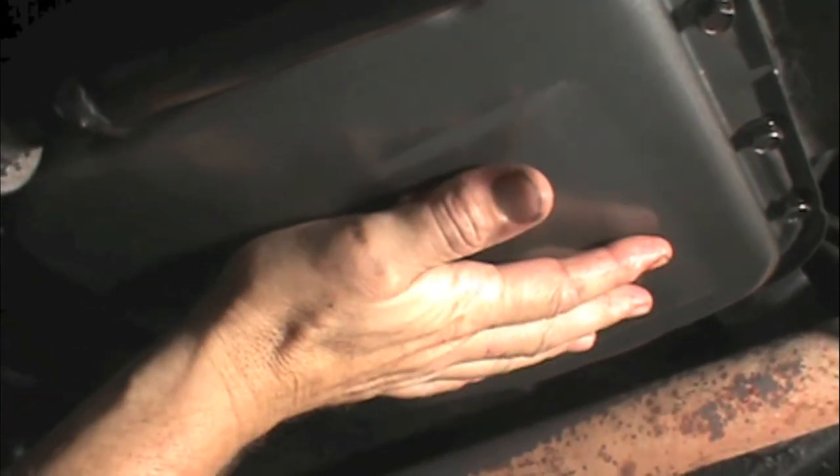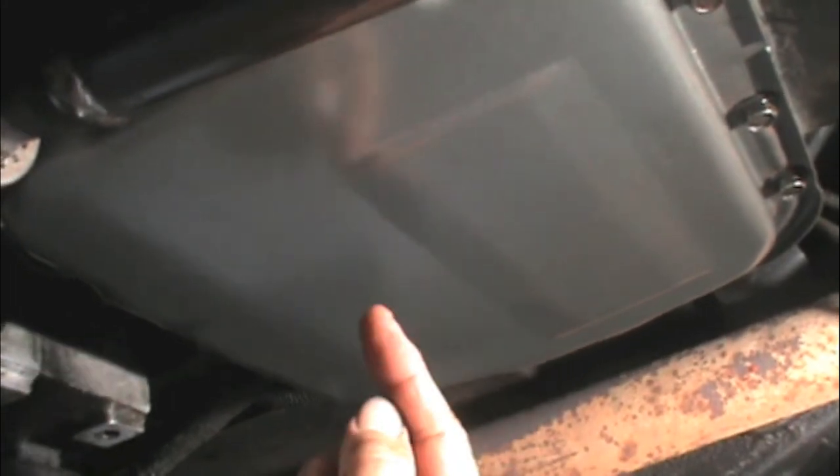You can see the finished product — the pan's in place. There's a little bit of the orange sealant coming out there, but I just wanted to make sure that gasket was on there, because that was my reason for changing it — my seal was leaking. Also, one extra note: when I put the filter in on this model, it's a '78, there was no ring that's part of the gasket that forms a suction seal. If you're doing a later-model truck, make sure you remove any round gasket that came with your kit, because it can get sucked up into the suction port of the transmission. Good luck with yours.